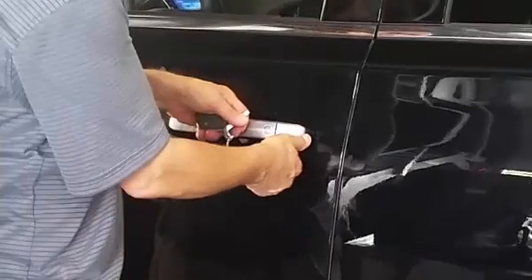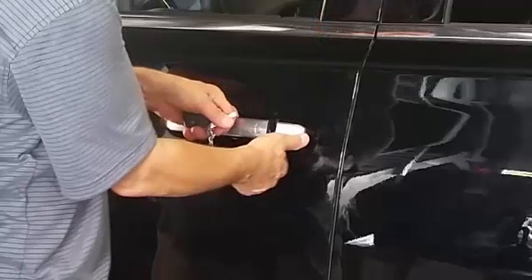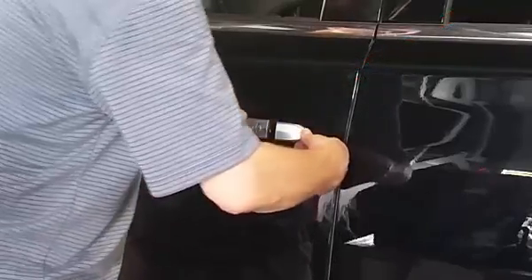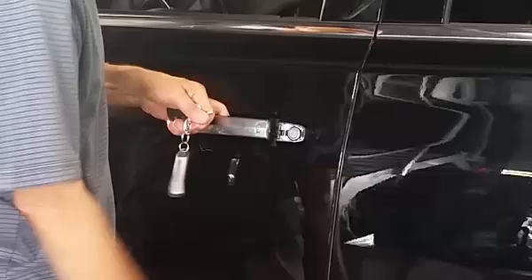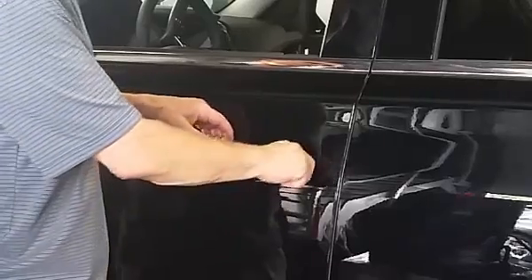On the Escalade, which we have here, a keyhole is not visible. There is an 1/8-inch thick cap at the rear of the driver's door handle hiding the cylinder. It needs to be removed. You'll first need to pull the door handle open fully as we've done. Next, slide the cap inward and remove it to expose the key cylinder. It will take some force to dislodge the cap. Once the key cylinder is exposed, insert the key and turn and you're in the car.